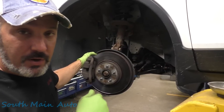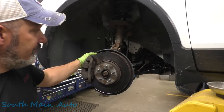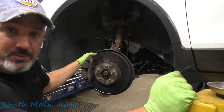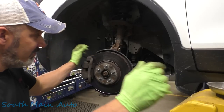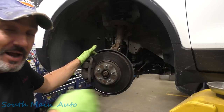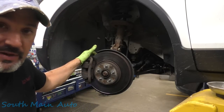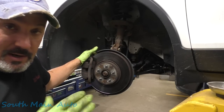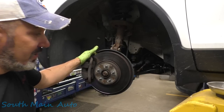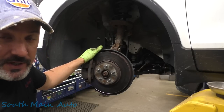So that's it, folks — lower control arms, outer tie rod on your Buick Encore, with the big 1.4 turbo. Use common sense when you're doing things. If you can't control yourself and you're not sure about fastener torquing and tightness, use a torque wrench. And obviously with everything, use service data. Don't lubricate the bolts — replace them. Follow it step by step and it won't lead you in the wrong direction. Just use your noodle and don't be a ding-dong — that's all I tell my kids too.